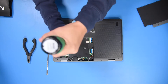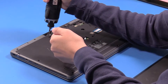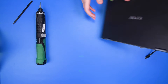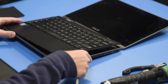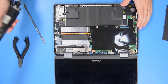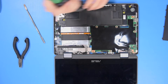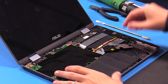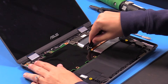And then take these screws out. You can flip the unit back over and pop the palm rest out. You want to take the screws out holding the battery in.